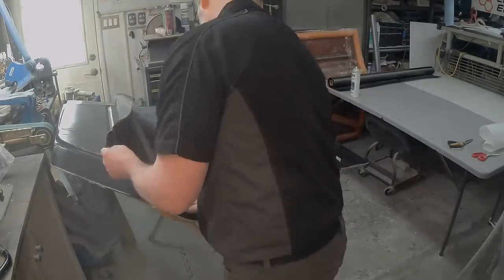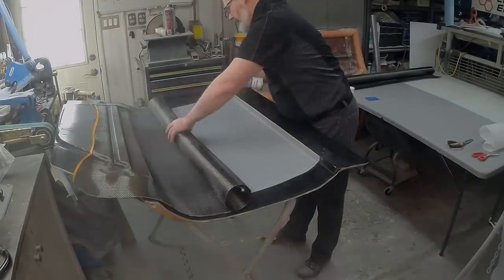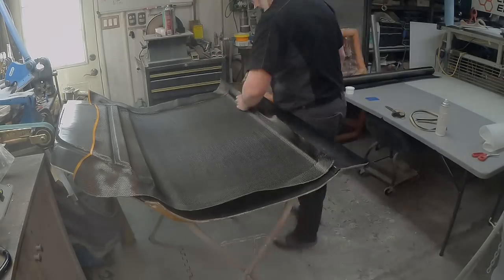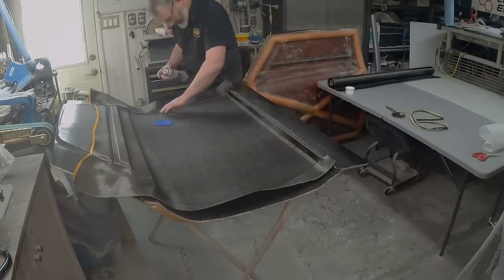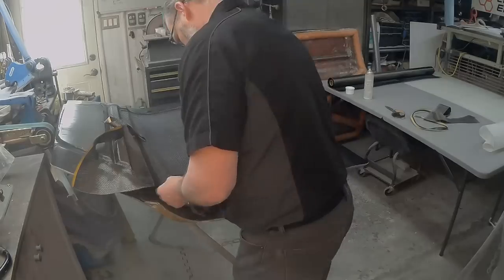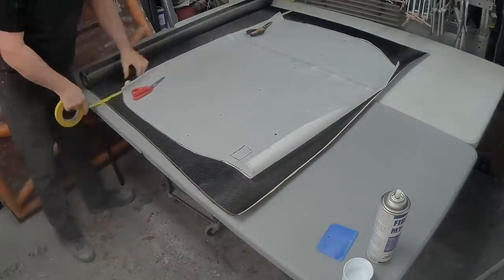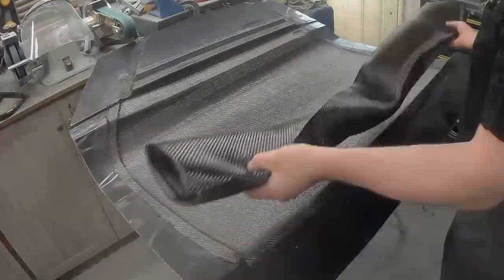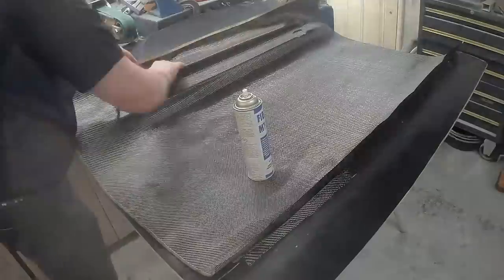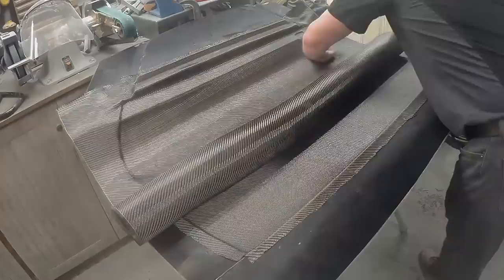You have to know the material weight in the mold — you can't be guessing; you have to use measurements to get the epoxy right. The fabric goes in pretty easily; I understand now why people like 2x2 twill. The blue bondo spreader is out to press the stuff hard into the mold. I'm being super careful getting the lay nice and straight, cutting off remnants to weigh up later, and getting all the edges tacked. The reason I selected four layers of carbon fiber was to match the thickness of the existing 18–19 gauge panel on the car, confirmed with online calculators.